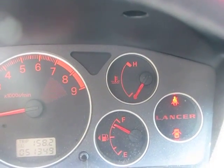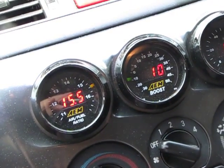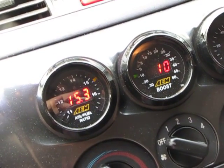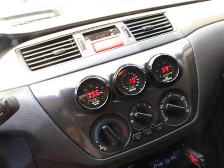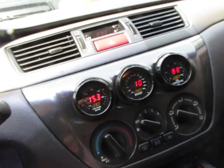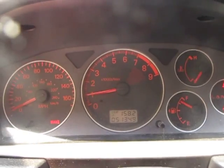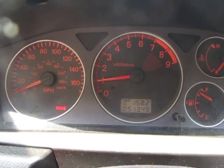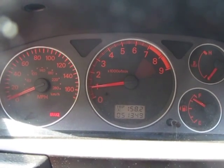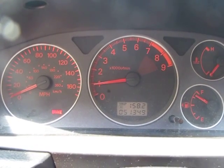It's still cold. The air fuels are staying within the 15s and 14s. RPMs are very solid, stuck to its target — no hunting at all, even with the modified idle air controller settings I did in the ISCV tables in the ROM.